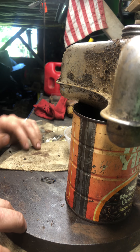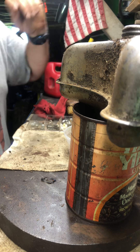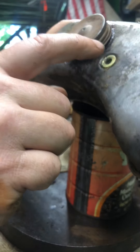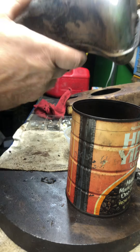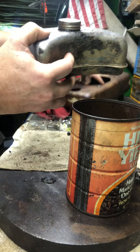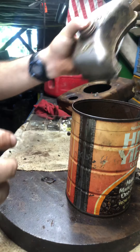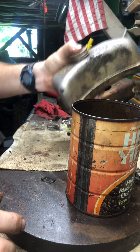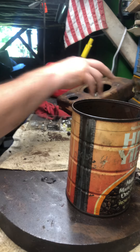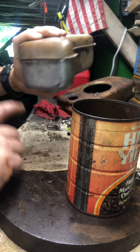So now, where did you put the cover to the gas tank? You just took it off — I saw you do it. Oh, I see what you did — you put it over there. So we put this back on here. These two holes on top don't go through; they bolt the gas tank to this cover. You might have to shake this — there goes our dirt, some of it. Let's get rid of it into the garbage pail. We'll clean that up later. Don't forget to do the top as well as the bottom.